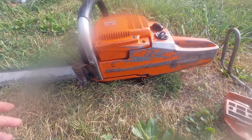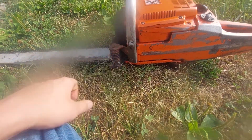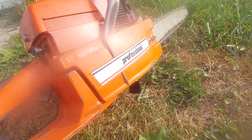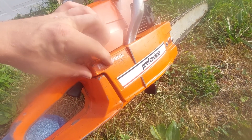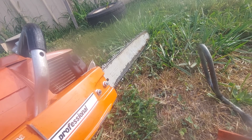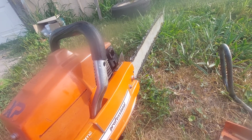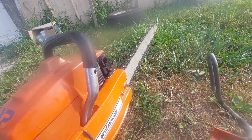This saw is worth putting some parts into. It doesn't have a whole lot of wear. It's got the extra mount up top like a lot of 288s have — it's missing a screw for the handlebar but I'm not super concerned, I'll find one. He put this cover on here for me and it's actually in really nice shape with just a little decal peeling and some missing paint. It's got a Husqvarna bar — it's an 84 driver — and he put a new loop of chain on it. It had a really low raker chain on it; after I verify it runs really well I'm going to put that original chain back on after I sharpen it, just to see what the guy was cutting with.